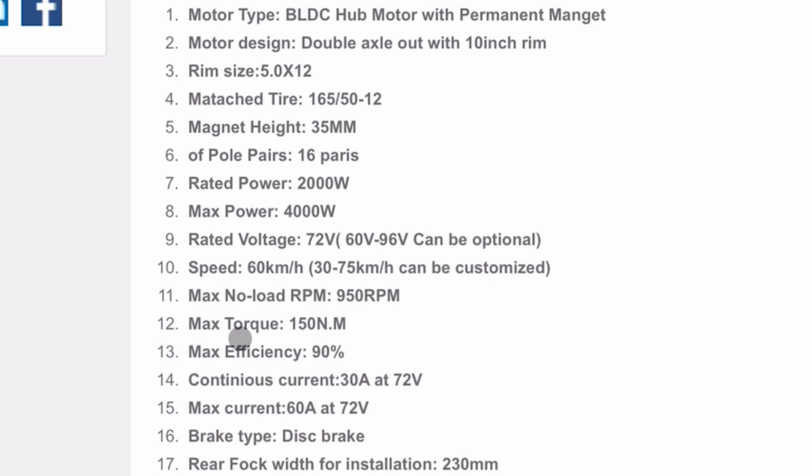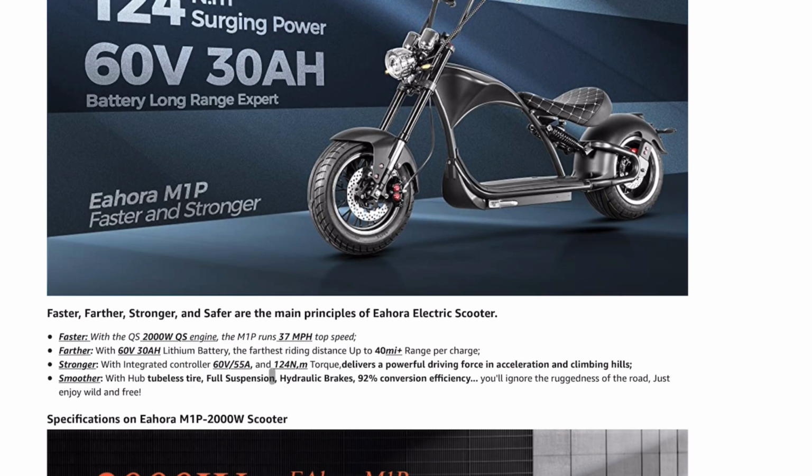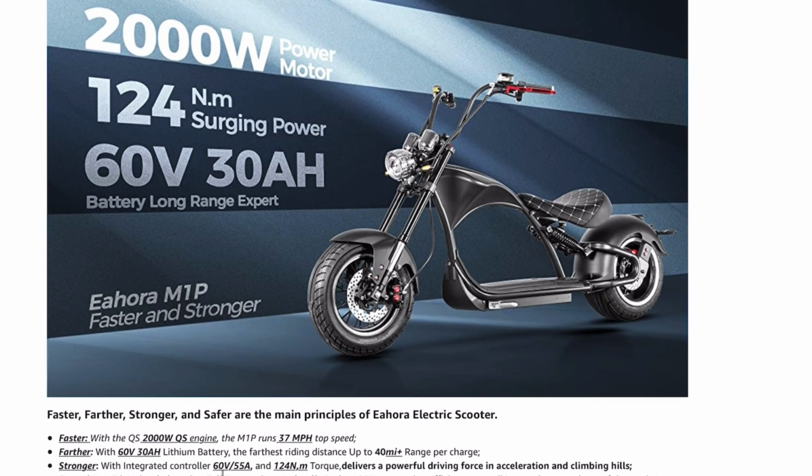But the final two bits of information here is the max torque, which is rated at 150 Newton meters, and the max current, which is 60 amps at 72 volts. And if we come back to the product page, in this configuration, they achieved 124 Newton meters of torque, and they're running at 60 volts, 55 amps. So there's definitely some headroom left if you wanted to, say, change out the controller and get even better performance out of it. Although I gotta say, these numbers are very impressive for an e-bike.